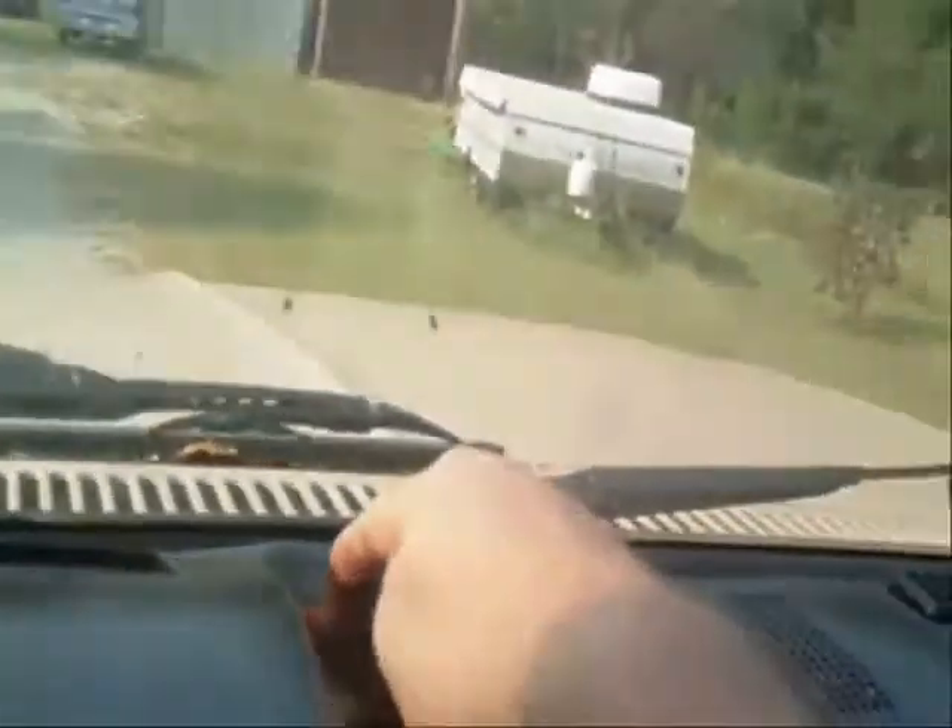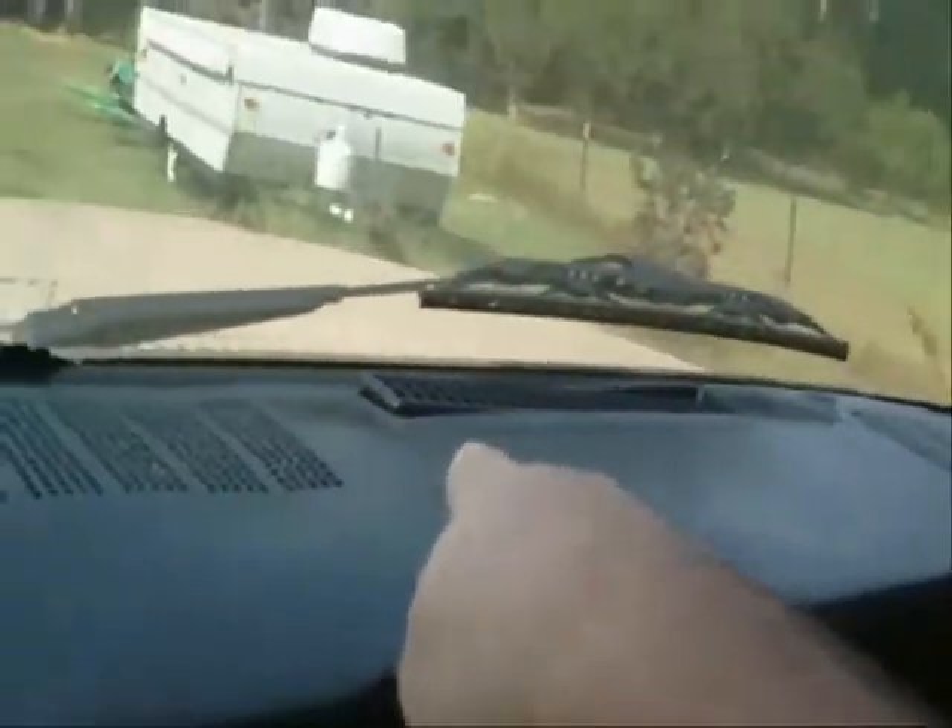Once I get this dash in, I'll give you another video. I don't really like how this dash pad turned out — this thing is bowing and warping in the sun. I also missed a damn install clip right here and it's bubbled up, and these pieces won't stay in. These aftermarket dashes just ain't got the thickness of the factory dash, so I'm either going to have to get a dash cover or figure out something else.